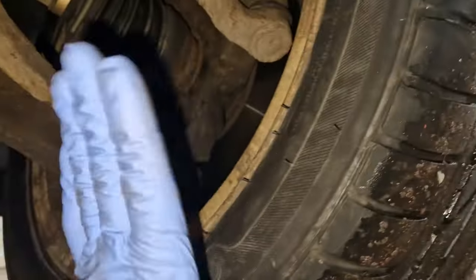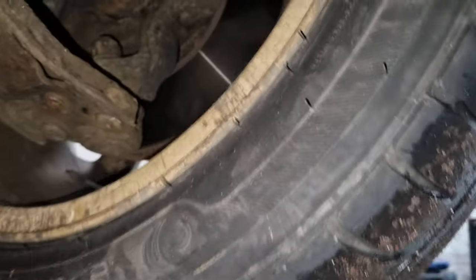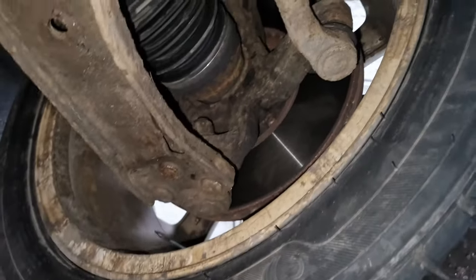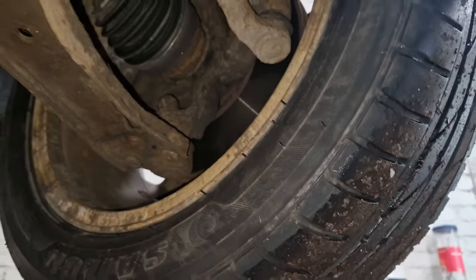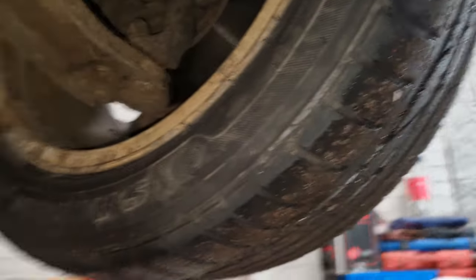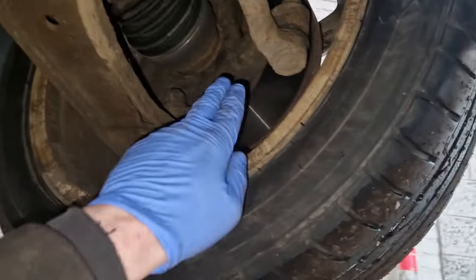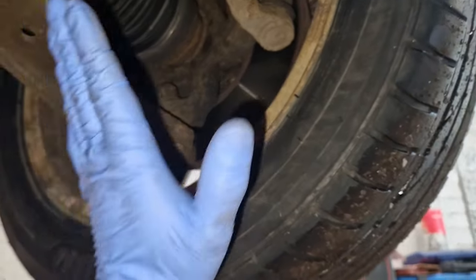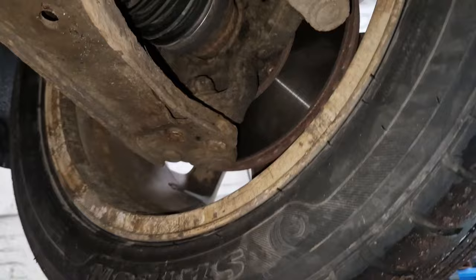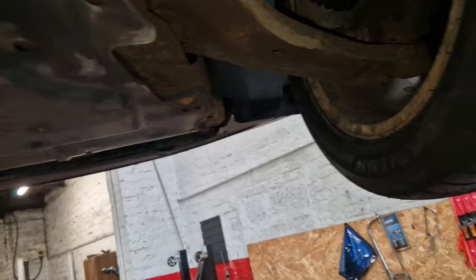The wheel bearing on this car doesn't have any snap ring or anything like that to hold the actual wheel bearing in — it's just an interference fit, a press-in type. The last Volvo I did, we did a wheel bearing on it and it came back about a month later with an ABS light on. I looked all over the car, pulled the sensor, couldn't find anything wrong. Then you could just see that the bearing had started to move, creating a bigger gap for the sensor. So we're doing an offside front wheel bearing, an offside front arm, and two anti-roll bar links.